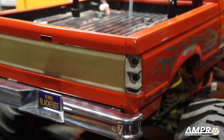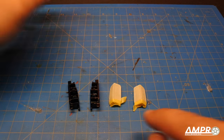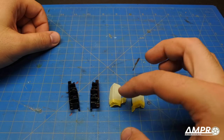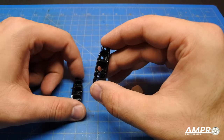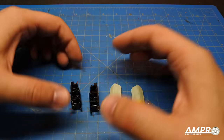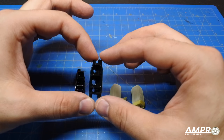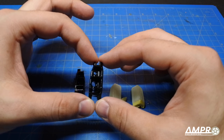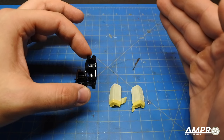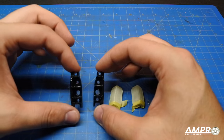I always get questions on what paint I use — it's not the right one but I'll show you anyway and give it a light coat. I have the reverse light portion masked off so I don't paint those sections red as well. Since we're doing a translucent paint, leaving these black could darken the appearance — though that might give you a smoked taillight look you like. Normally I recommend painting these silver. On the nylon production pieces, which come in white, red, or black, I recommend buying the black ones, painting them black with a couple of coats, then painting the insides of the bucket silver — that way you'll get no light bleed.